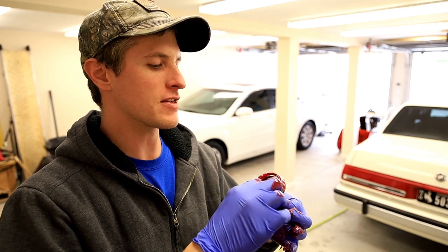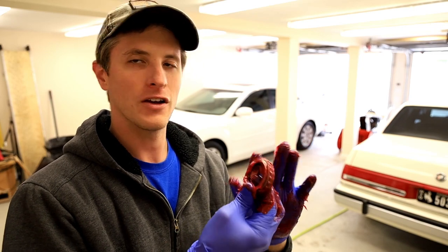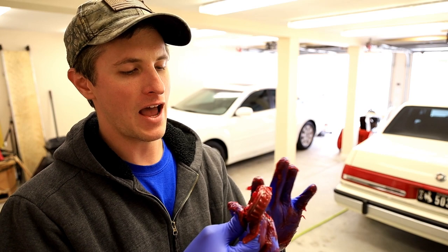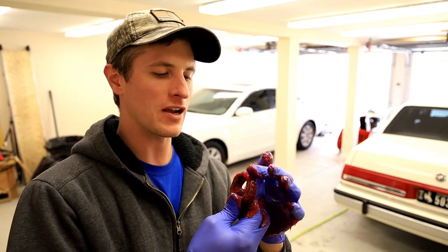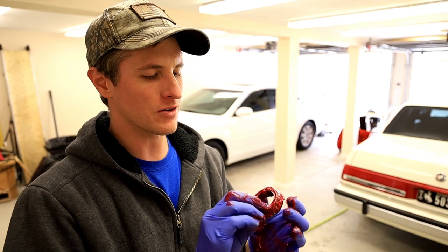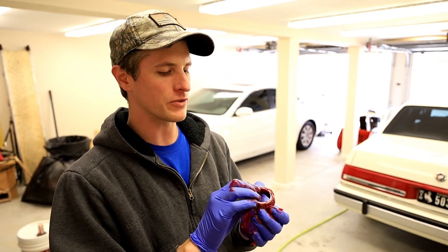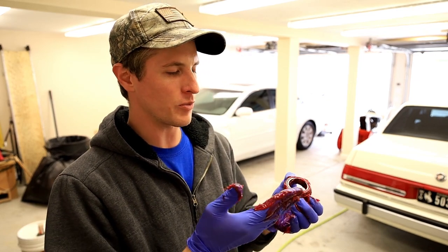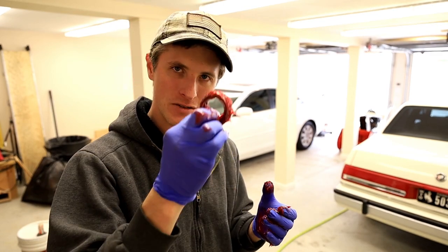Anyway, the only thing I'm gonna tell you about grease is, yes, there are certifications for grease, and the only one I really care about is that it has the wheel bearing designation and that it's disc brake safe. So not all greases are able to be used on like front rotors and stuff on the older cars. That is about the only thing that I'm gonna talk about. Valvoline, Royal Purple, Napa, whatever makes you happy. So let's do the other bearing.